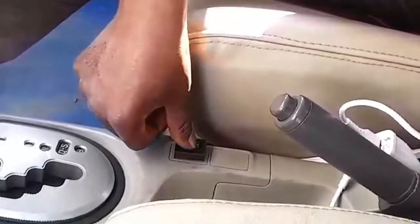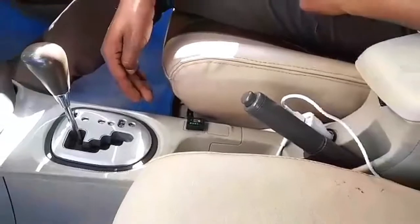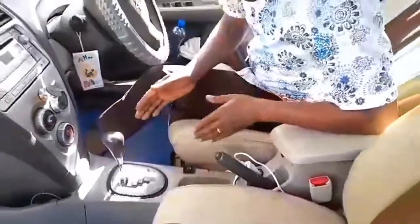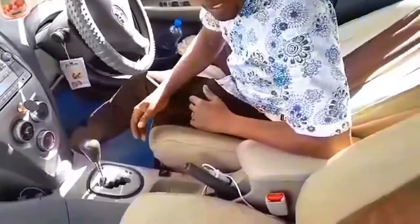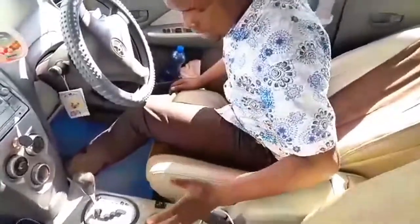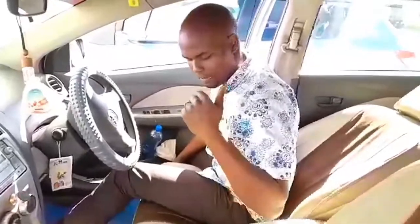Let's switch off and switch to LPG. It takes a few seconds to switch from petrol to LPG. But this one, instead of turning to LPG, this switch starts to blink and it gives a service signal. So our first diagnosis: the first thing we are supposed to make sure is that we have LPG in our reservoir tank.